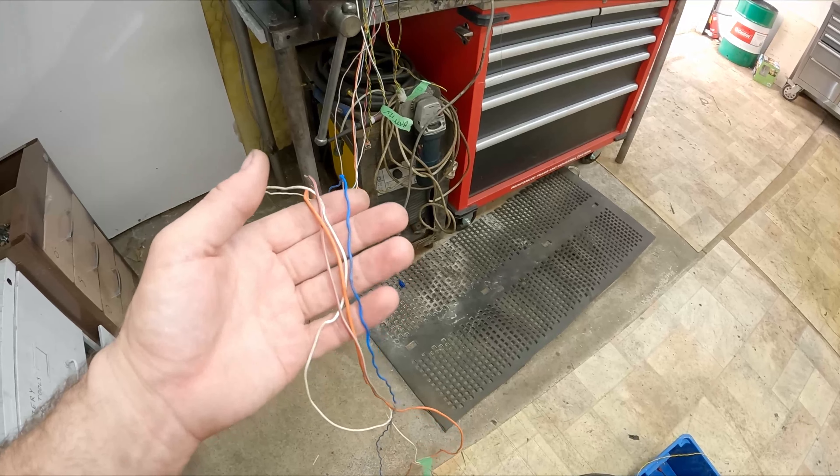A lot of people, don't let it upset you — there's not that many wires. I'm going to put these crimps on the ends and put them into the appropriate slot. Whether you're using a Haltech, a G4, Micro Squirt, or anything like that, this process will be different for your ECU. I'm using Haltech — it's really nice in that I can designate a wire pinout, print the pinout, and just go off of that and insert the wires into the correct slot.